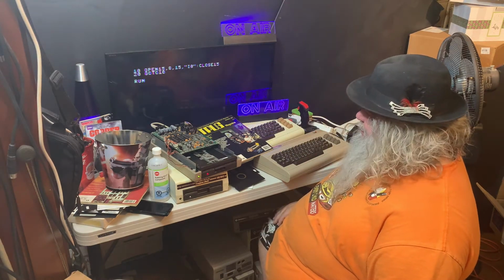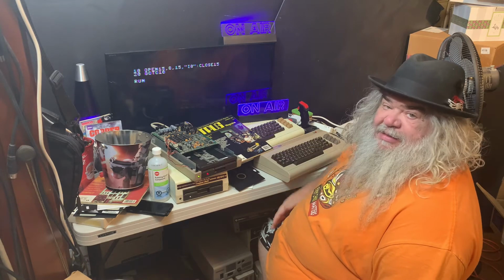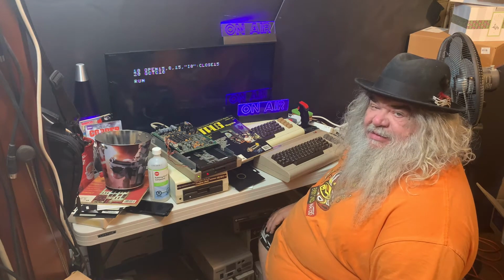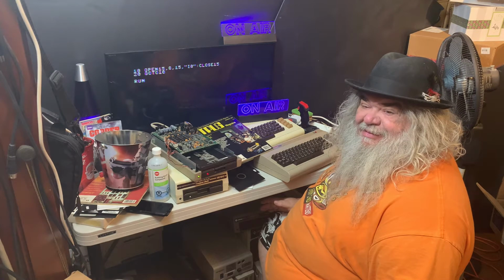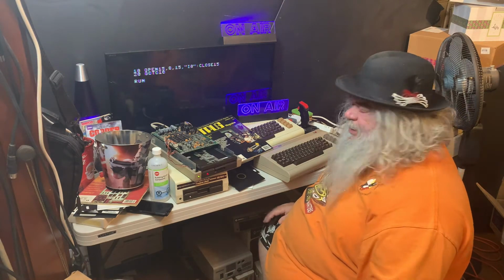But if that is the case, then all I have to do is take off the screws, clean the head, let it sit for a little bit, give it a test, and probably it's fine. It's rare that it would be anything else after just sitting. It could be alignment, but I don't think so. I think it's just microscopic scunge has infested the head. Or who knows, maybe some bug got in there.